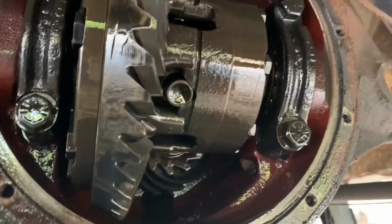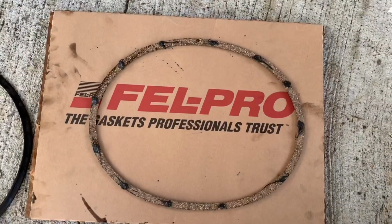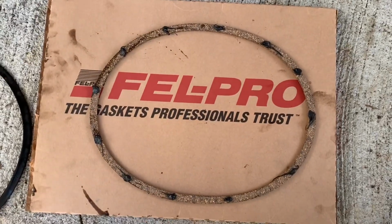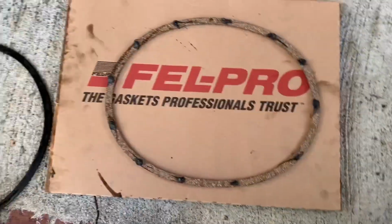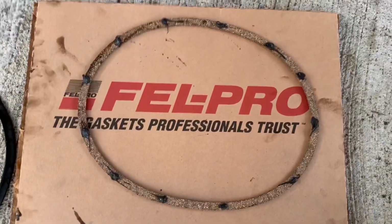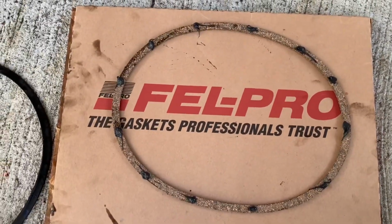And then we're gonna throw the new gasket on and put this cover on after I clean it up a little bit. As you guys can see here, I put a little bit of RTV on the differential gasket, and what that'll do is basically help me put it into place and keep it there while I line up the cover, as well as help it seal for the future so that nothing else leaks out.